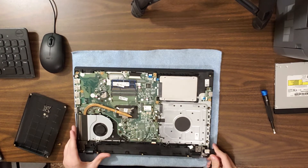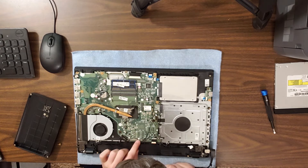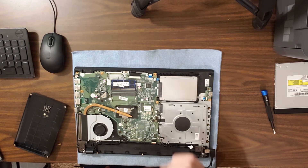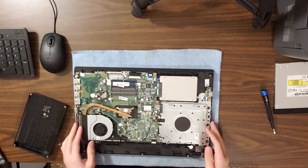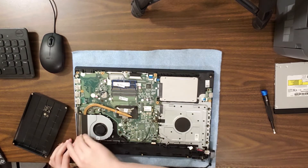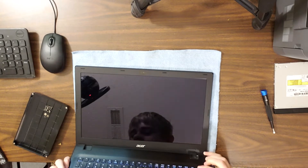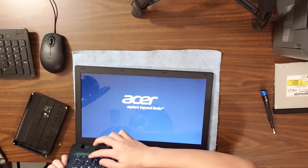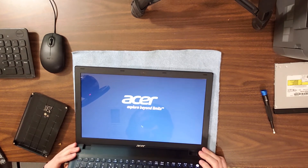With the battery removed, I'm not hearing anything. So it could just mean we need a new battery, or we have some broken components around the battery — the transistors, all the components that allow power transfer to the battery. Let's try powering it on without the battery installed. And would you look at that — we get a keyboard backlight and we get a POST. I was trying to get into BIOS but I didn't click fast enough.